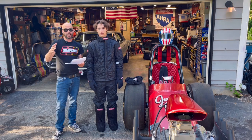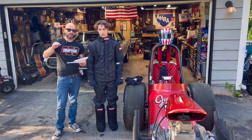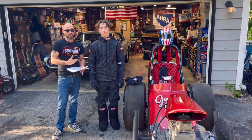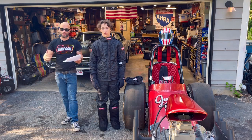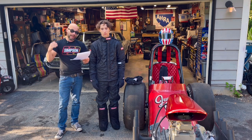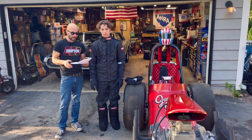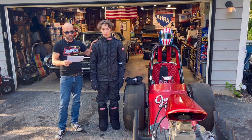There is what's called a TPP. It's a thermal protection performance. So when you see something like 3.2-15, that's the rating. With this dragster, the minimum I had to have on the fire suit itself strictly said 3.2-15. So there's different ratings with it. The 15 means it's a burn rating of 30 seconds. And that's based upon a gasoline fire to protect against second-degree burns of 1,800 to 2,100 degrees on fire. Never want to be on fire, but just in case, this multi-layer suit here will help protect that.